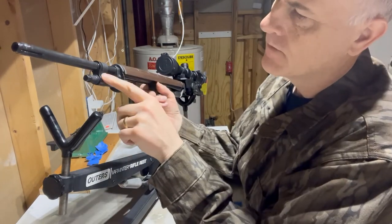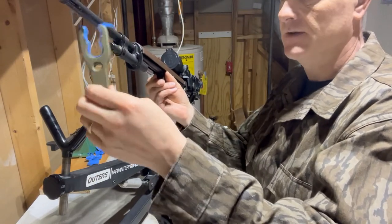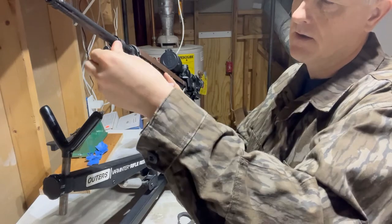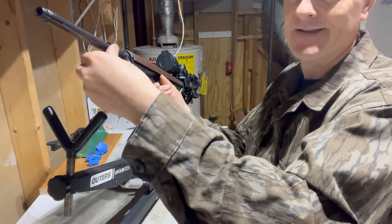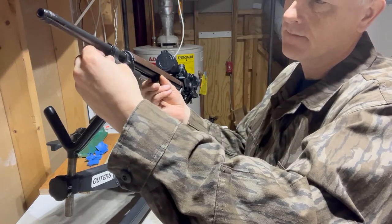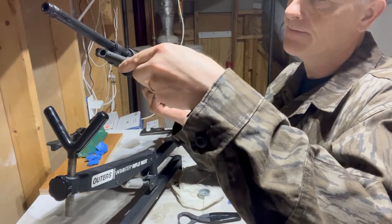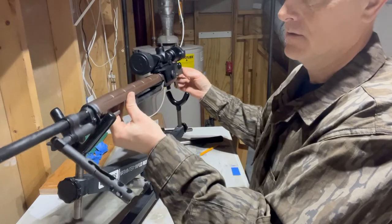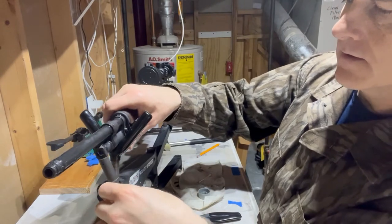Okay, so I just took the wrench here and adjusted, made sure the lock ring was centering on the front of the gas cylinder, and then it's turning now, hand tight. Still feels a little grainy, so hoping I didn't do any cross threading. So now I'm going to snug it with the combination tool, just want to put that a little forward of the rest there.